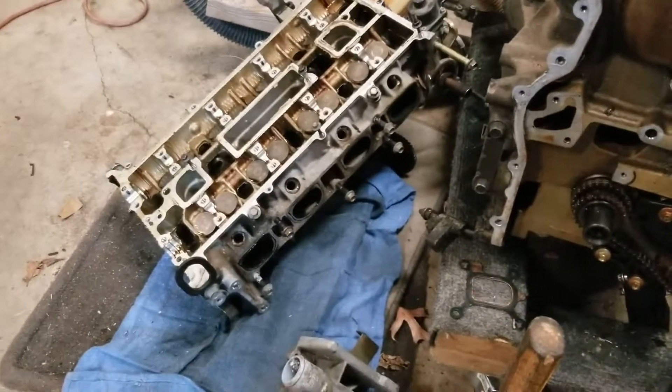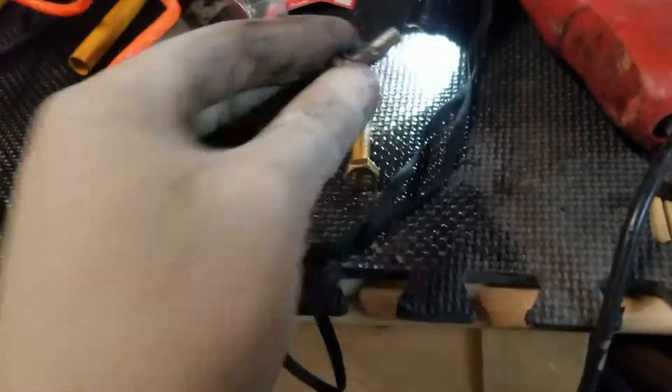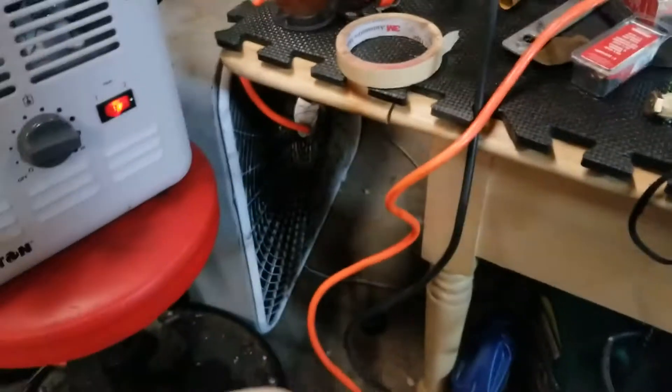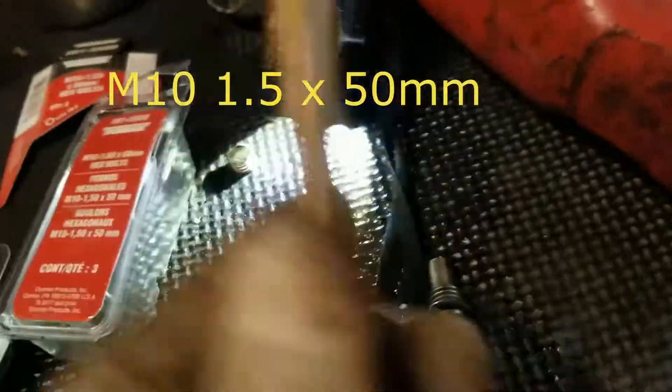When you're doing a head job — I got another head that was clean, machined, and it's on the car right now — but I'm in the middle of timing the engine. To time it you need a special tool. This one is actually too short, but there is a long one you can buy for about a hundred bucks. Basically what it does is it pushes up against the weight on the crankshaft and keeps the crankshaft from turning. So instead of spending a hundred bucks, I decided to make one of my own. Here's what I did — that's the bolt I use.